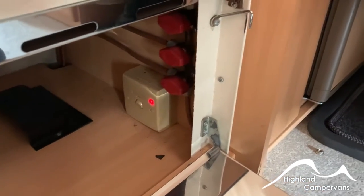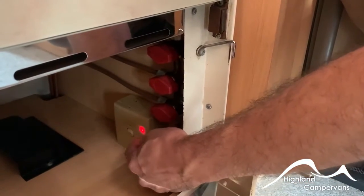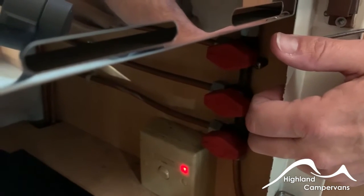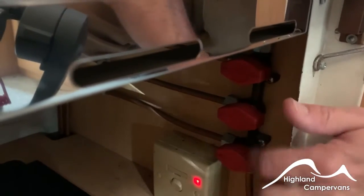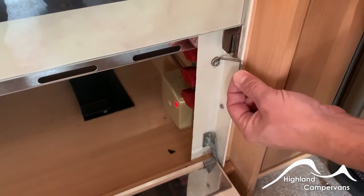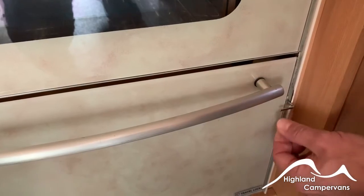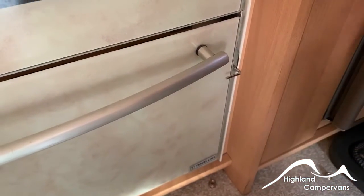In the area of the cooker there are a couple of things to be aware of. Under the cooker there's an electrical switch — it's illuminated and it's the master switch for the fridge, so if the fridge is on mains and something knocks against it you may find the fridge will switch itself off. Adjacent to that you've got three individual isolator taps — these are the gas feeds for the hob, the fridge and the cooker. In-line they are on; if they're rotating through 90 degrees that will isolate the supply. When you open up the locker door at the base there's a little metal bar — when the door is shut there are a couple of magnets, but always make sure that little metal catch is turned back over the glass door so that if you go over a bump it stops the door from falling forward and smashing the glass section.